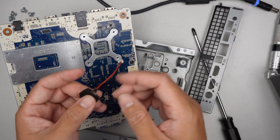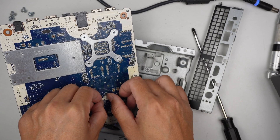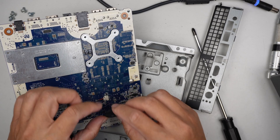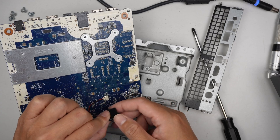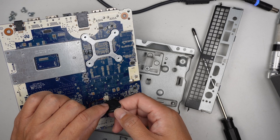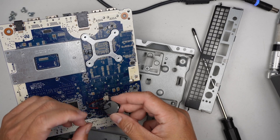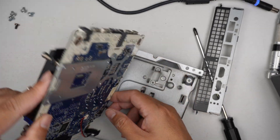I have to DIY the CMOS battery here — I do not have exactly the same one. I'll remove the old battery, replace it with a regular CMOS, get some electrical tape, and tape it together. The plus side is for the red wire and the other side is for the black. The metal is touching at the bottom of the CMOS. Then get the heat gun, reheat it, and warm up the electrical tape to get it sticky and glue them together. Hopefully that works.